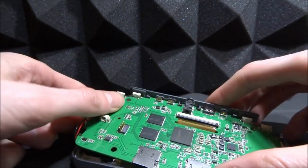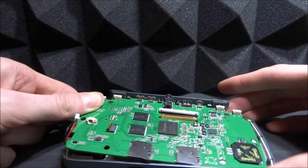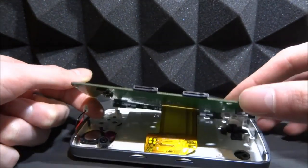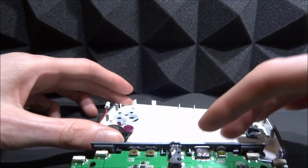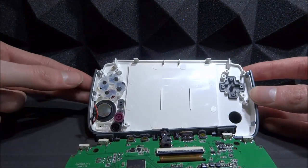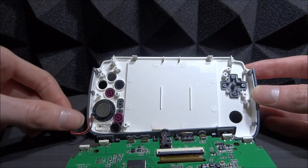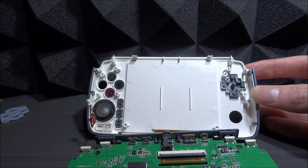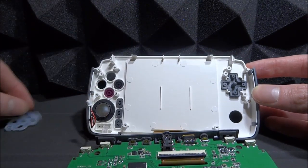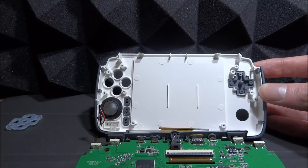With the volume cable pulled out, we should be able to rotate the screen around and edit the buttons quite easily. Just wriggle it a bit out of the case and lay it down like that — you don't really need to disconnect the screen ribbon cable. Now the buttons have fallen out. This is where each button goes, and this is the rubber pad which covers the buttons. We're just going to tap those out as well, and now we can install our brand new buttons.